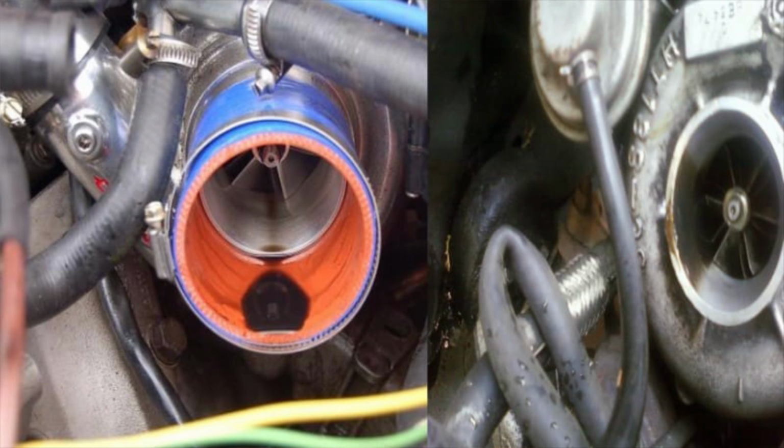Just one little tip for boost pipes. If you ever take a boost pipe off, or any kind of intercooler pipe work, take the pipe off, use some sort of cleaner, whether it be brake cleaner or some other anti-oil cleaner, wipe the inside of the pipe, wipe the external of whatever you're slipping it onto. Good Jubilee clip, never have a problem.